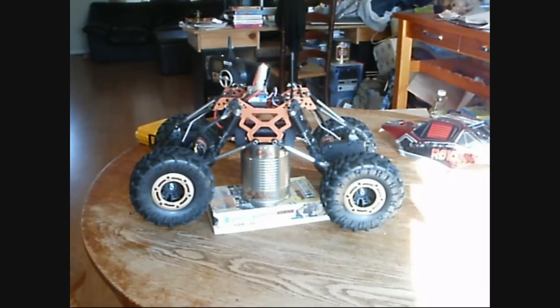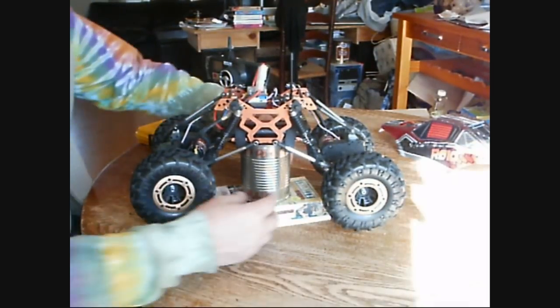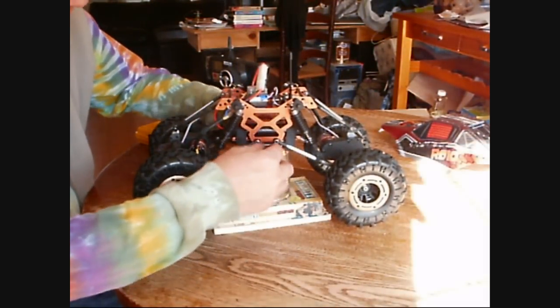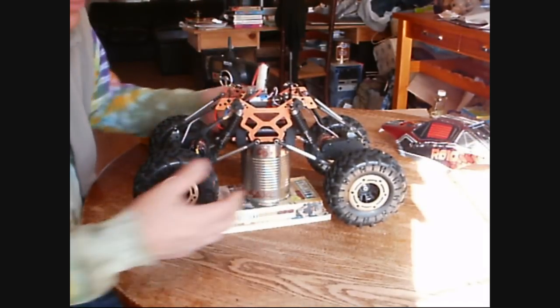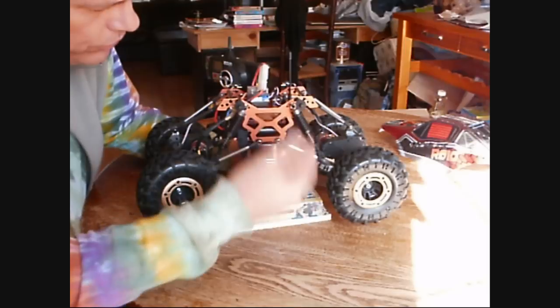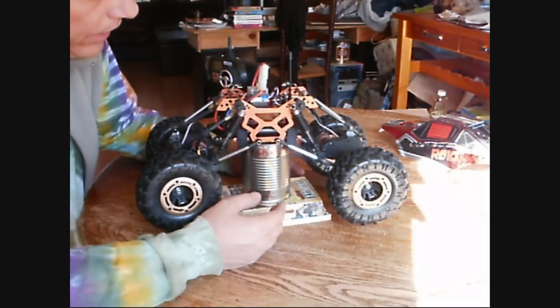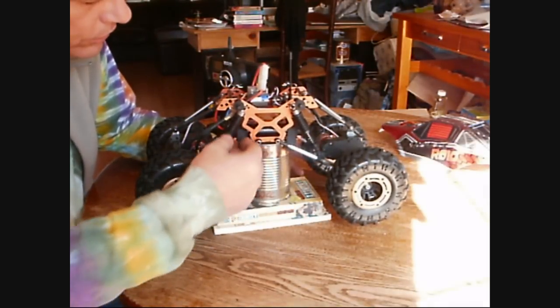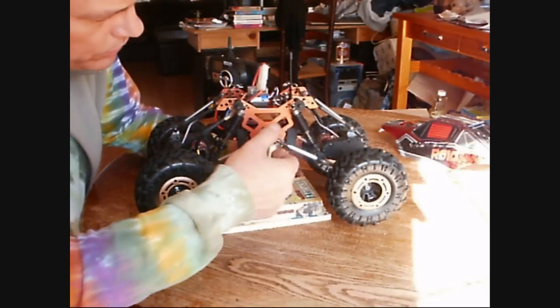Okay guys, got the wheel put back on. I wanted to touch on a couple other little things I had to deal with right out of the box. First of all, I made like a little way of just setting it up so it wouldn't affect the suspension. The suspension's not touching it, so I can check everything. And one thing I was noticing was that it wasn't dropping the same all the way around. So I took a quick look at the shock, took the shock out, measured it, took the other shock out, measured it. There was over 1/8 of an inch difference in extension length.